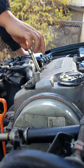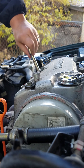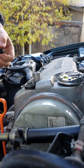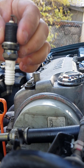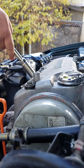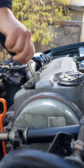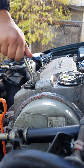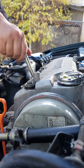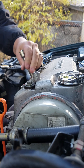It cost me over $200 to do — it was really bad. I don't recommend you do that. If you find it is a little bit too tight or too strong, don't risk it. If it's your only car, do not risk it at all. Here's spark plug three — another Autolite. These spark plugs are totally fine visually. As you can see, it's been gapped, everything's been working fine, barely any soot on it, no gas, no oil or anything. So that tells me my oil seats in the main are correct and not leaking at all. It's just been running really bad and I'm noticing it just wants to roll over and die. My distributor's brand new, so is my cap and my rotor — my rotor's an MSD. Air intake is K&N. I have an Edelbrock intake manifold, a Skunk2 fuel rail. I just have a lot of parts underneath the hood of this car.